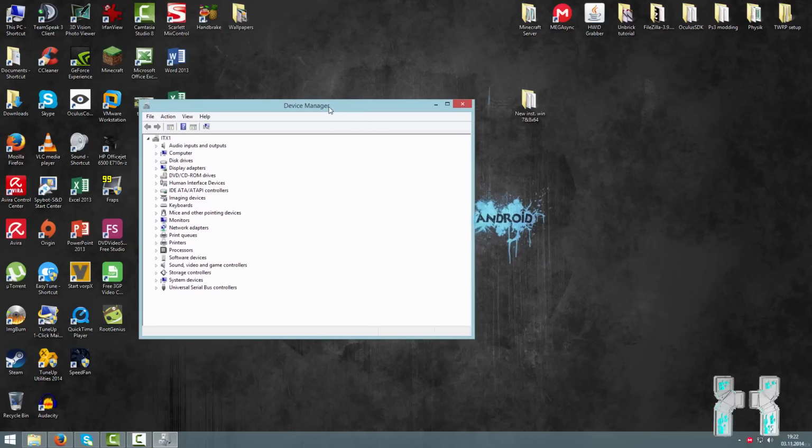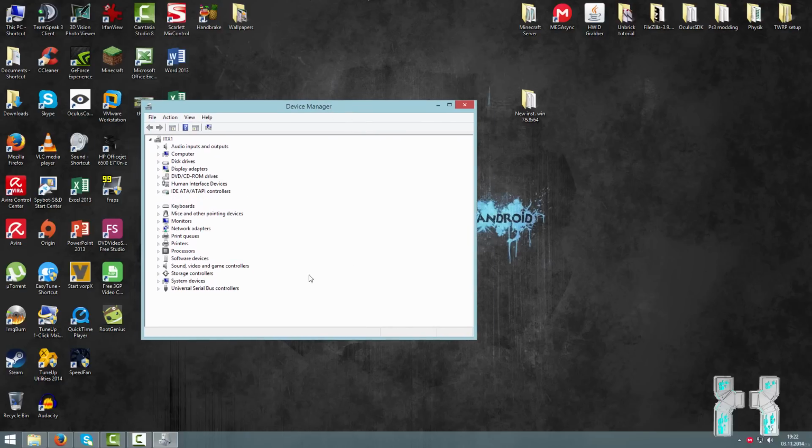So now we are in the device manager and we just keep this window here open. Now, as I've told you before, just make sure you connect your smartphone without battery as always, and try to hold volume down or any of the volume buttons, maybe also with the power button, to see if it gets connected, okay? And I also want to show you what it does if you have a disconnecting and reconnecting preloader. So let me just quickly show you how it looks on my smartphone.